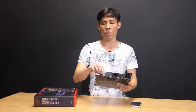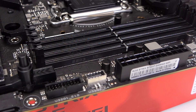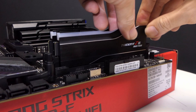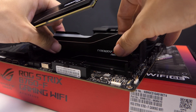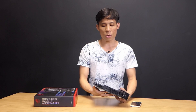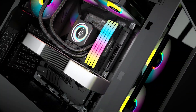This is a DDR5 motherboard, so you can install up to 4 DDR5 RAM sticks. One thing to note — I'm not sure if anyone has fixed whether you can get the full rated speed with 4 sticks. For example, if your DDR5 RAM runs at 6000MHz, will you actually get 64GB at 6000MHz after XMP? Hopefully there'll be a solution in 2023 for running 4 sticks at full rated speeds, even up to 128GB.